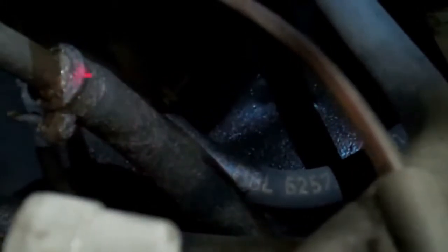The power steering low pressure hoses are also starting to leak a little bit of power steering oil. It's not a big leak, but there is oil coming from the left side of the car. You can see this hose right here is really wet and looks old — it should be replaced. There's another power steering hose a little bit lower that's wet as well, so we're going to recommend that you change both low pressure power steering hoses.